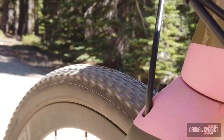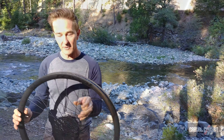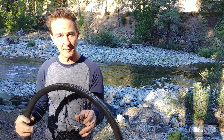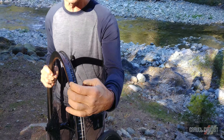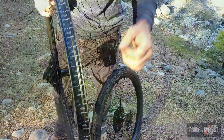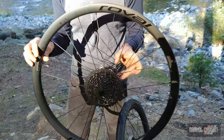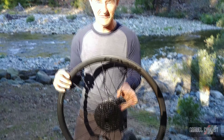We wanted to make the ride quality really smooth, so we worked on the layup and the geometry of the rim to make it really smooth riding. The CLX, because it's a 25mm, you can run as narrow as a 28c tire if you want. It's got a hook bead so you can run full pressure. It's the lightest clincher wheel we've ever made at under 1300 grams, but it passes off-road standards and it's ready to go.